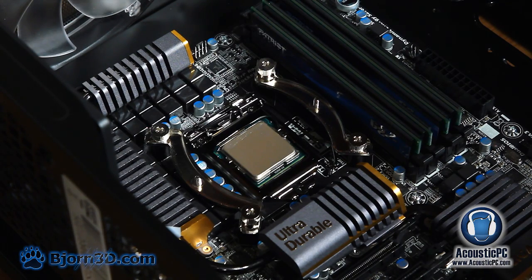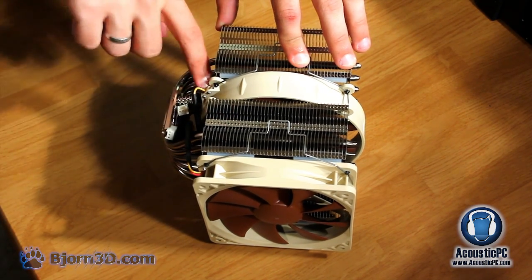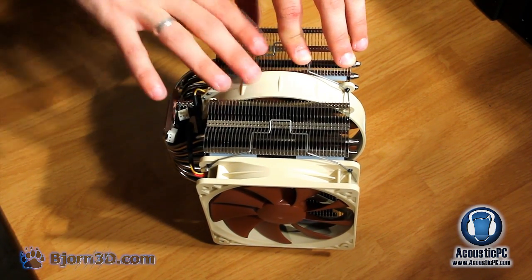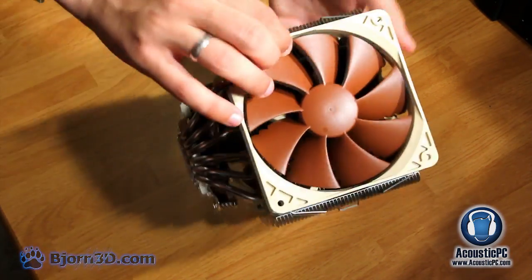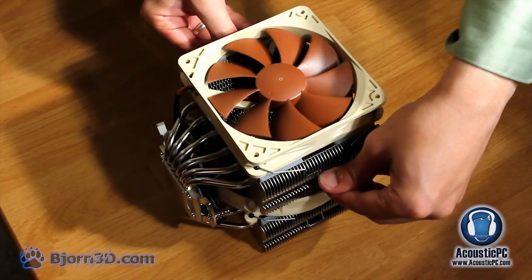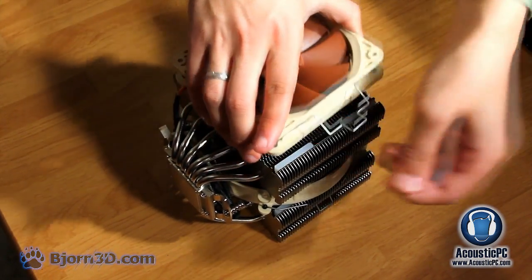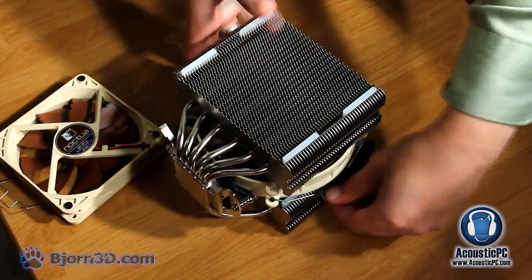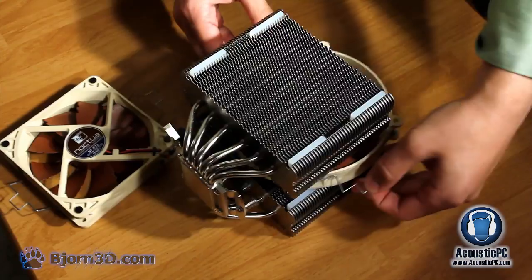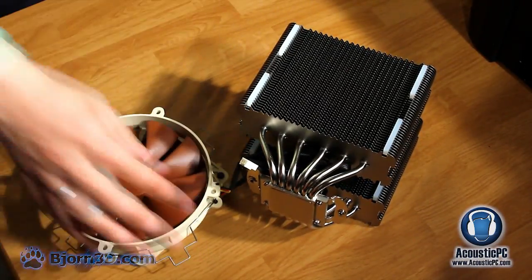After the thin layer of thermal paste is spread throughout the CPU, we're set to set up the rest of the cooler. Our cooler, the Noctua NHD14, is equipped with 2 fans, which unfortunately obstruct access to the screws in order to mount this cooler. So we're going to have to remove these fans. In order to do so, we'll simply unclip them. Noctua fans are really easy to work with. Just like we did with the outer fan, we can do the same with the inner.